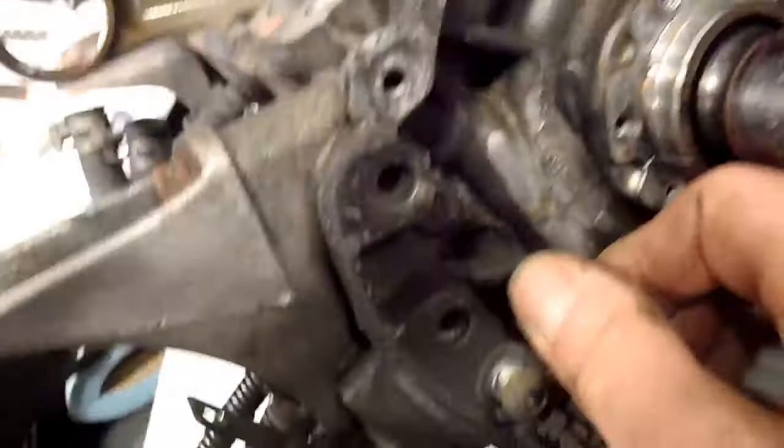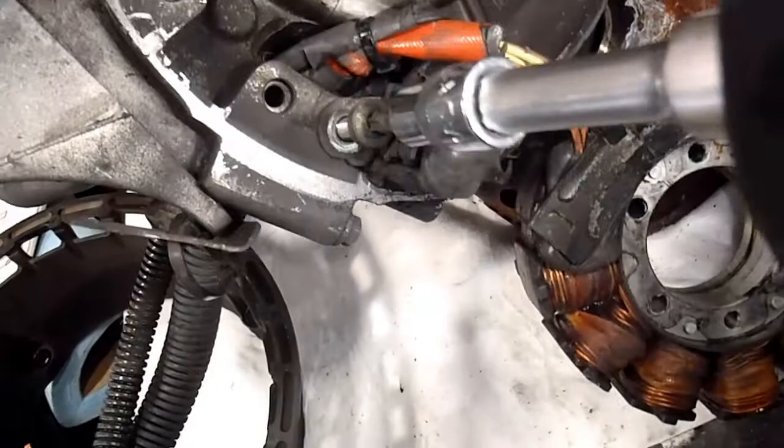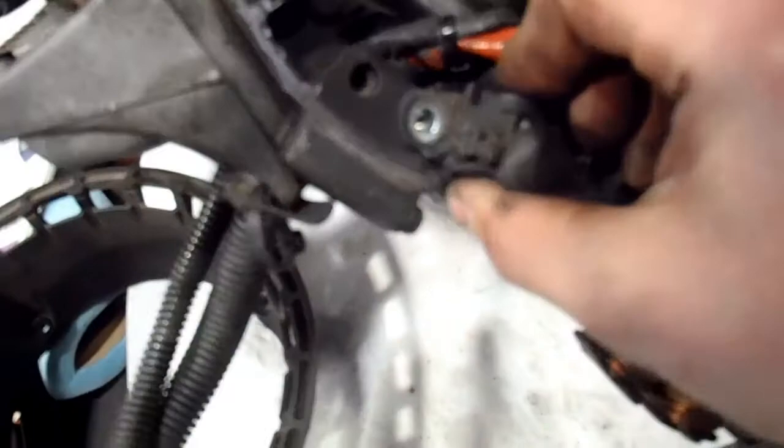There's no doubt that this is a lot easier to do with the engine out of frame. I'm going to have to take this pickup coil off. I found that it's a T50 or something, but a plug wrench works - a chainsaw wrench. Different length Torx for this. It looks like it's still glued in there, so just work that off gently. The grommet's out.